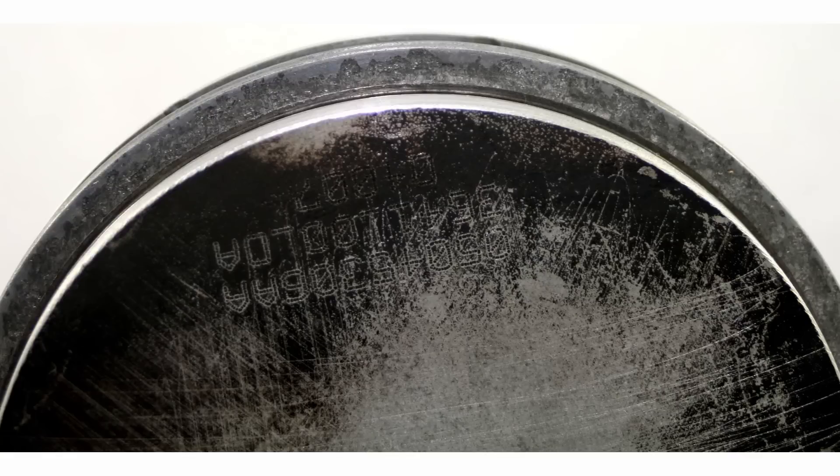What is ring groove microwelding? Ring groove microwelding is where the piston material is transferred from the piston to the ring. This inhibits the ring motion in the groove and equates to lost ring seal and lost horsepower. The microwelding process is a rough form of diffusion welding, where two materials — similar or dissimilar — are pressed together under high temperatures and pressures and bond to each other. This happens when the compressive strength of one material is overcome and bonds to the other. Adding motion to the two mating surfaces aids this process.